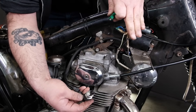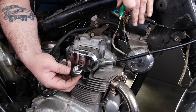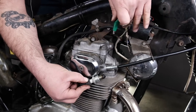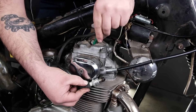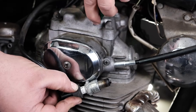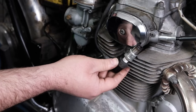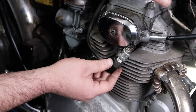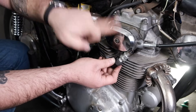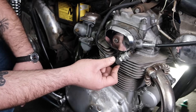Just like the left side, we have to check the right side because they are parallel but independent circuits. I have the spark plug out for this side with power running through the right side coil. I attach my spark plug body to ground and hook my alligator clip to the blue wire coming out of this coil. I strike it against ground and every time I break the connection it sparks — our coil is good, making a nice purple spark. I've plugged in the right side ignition point to the right side coil. Now we should have full contact from ground all the way through the positive side of the battery, and we should be getting spark. Kill switch to on — let's give it a kick with the kickstarter.